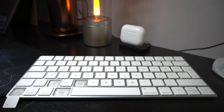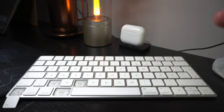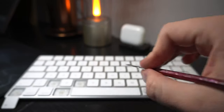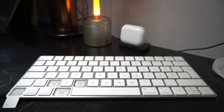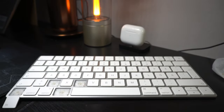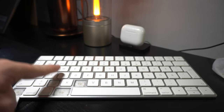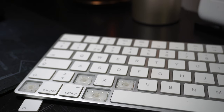I'm not going to take off every keycap, but if you want to take off the spacebar or other large keys, you do the same as with this button or the laptop — you go under, there is this plastic part, you do the motion I showed, and do it here and here and also the same with the other side. But remember, before you start taking off the spacebar or other hard keycaps, just train yourself with the easier ones first.